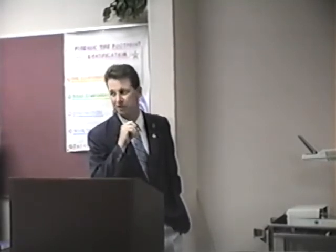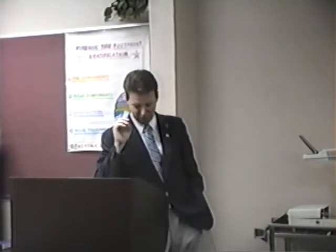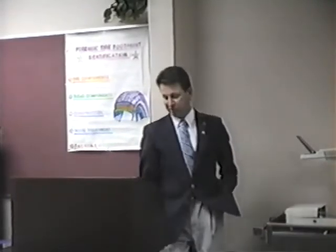So if you get one that looks like two thin tires with a big wide groove down the middle of the crown, right away you're looking for a Goodyear AquaTread. It will not be original equipment. It's going to be replacement, because of the CAFE requirements, that one is just slightly under CAFE requirements, I guess. Although it's a great tire, according to Goodyear, it provides excellent traction. The rolling resistance isn't as low as it is in some other tires.